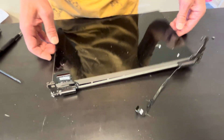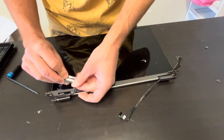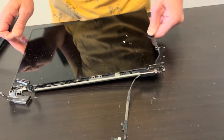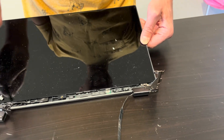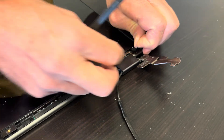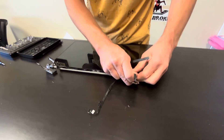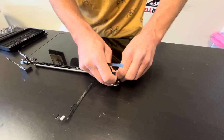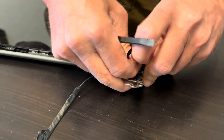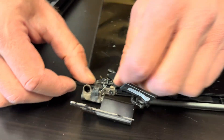That's our screen — as you can see it's very fragile and usually sold in one piece. It's very hard to take apart this kind of screen, so I would advise looking for the whole screen assembly. That's the part number on the video cable. If you want to try to pull out the screen, take out these screws, then find the adhesive strip sticking out here and pull it out gently. This adhesive strip on both sides is what holds the screen in the back cover, and it's pretty easy to break if you pull too fast.